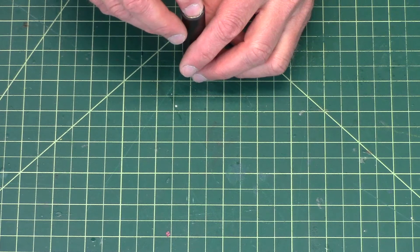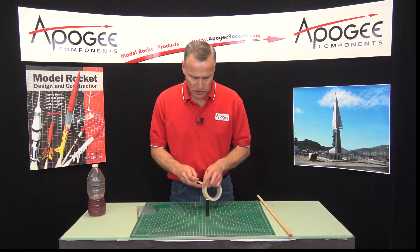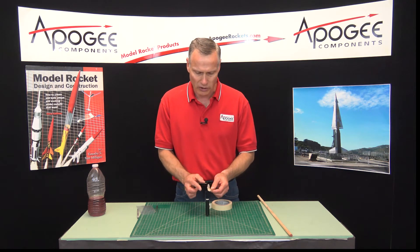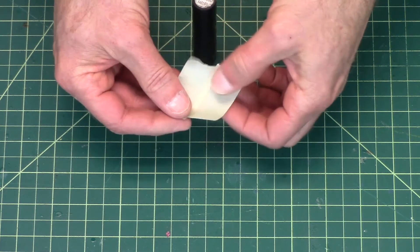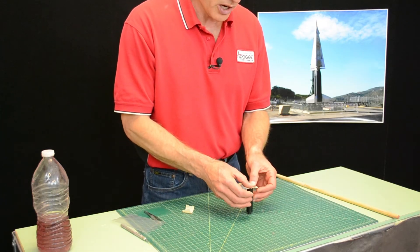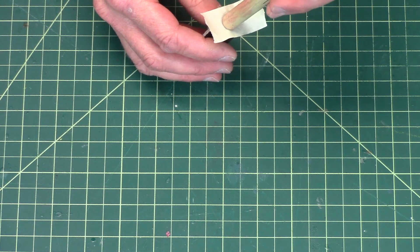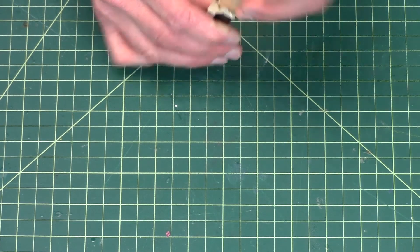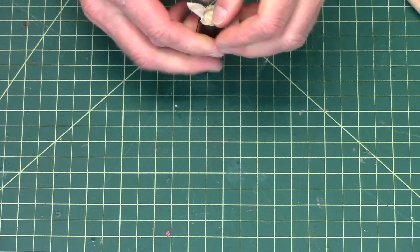Now if it doesn't want to stick — this one is very loose because it's got so much black powder on the adhesive — you can take a piece of tape and put it on top. If your motor is wider than one piece of tape, just take two pieces of tape and lay them together to make it wider. Then lay that over the top and find something like a wood dowel that's very close to the diameter of the motor and push it in, working it around the edge and then pushing it down.